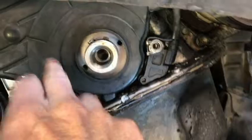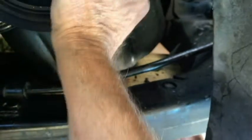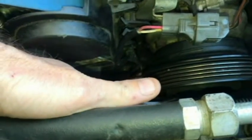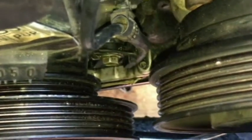Replacing it will be in reverse, really. I'm going to go ahead and put the crankshaft pulley in place. Now this is only going to go on one way — getting the keyway lined up. Just follow the wire down there and you'll see it right next to the crankshaft pulley, the harmonic balancer. That's the bolt right there. It's much easier to work from down there. Thanks for watching the video. Until next time, have a nice day. Take care.